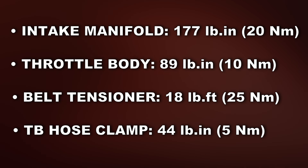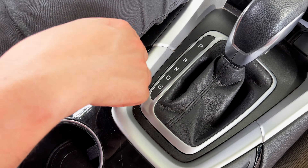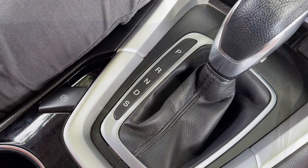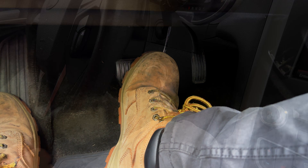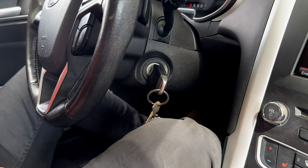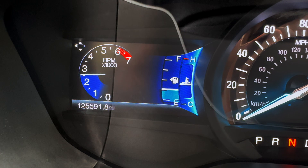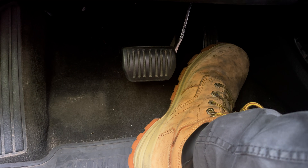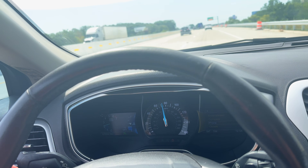Once you've got everything done, it's time to make your vehicle's computer relearn the idle. This step can vary from car to car, so check your owner's manual for the correct steps. For my vehicle, the first step is to set the parking brake, make sure the transmission is in park, and turn off all accessories like the lights and radio. Fully press on the brake pedal and start the car, then run the engine until it reaches normal operating temperature. Let the engine idle for one minute, then press the brakes and shift into neutral. Press down on the gas pedal for one minute. The last step is to drive the car for 12 miles to complete the idle relearn strategy.